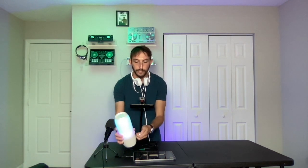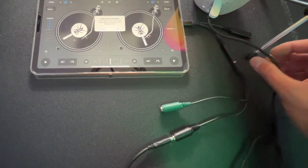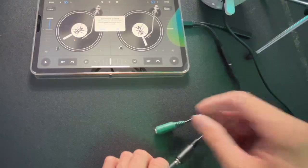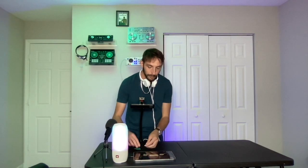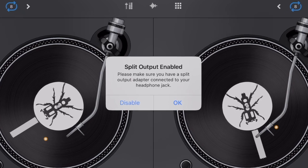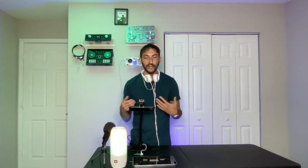This one's going to go into our speaker — I'm just using this little Bluetooth speaker. Obviously I wouldn't use this at a big large party, but maybe hanging out in the backyard that would be fine. So now that's plugged in. We have our audio cable plugged into our speaker, we have our adapter plugged into our iPad, and now we have this extra port. So all we have to do is plug in our headphones, and you will see on the screen it's going to give us this message: 'Please make sure that you have an output splitter.' So this is just recognizing that you plugged in a splitter, so we're going to press OK.